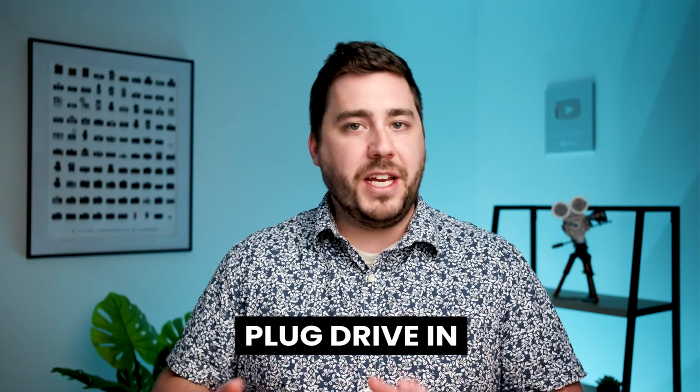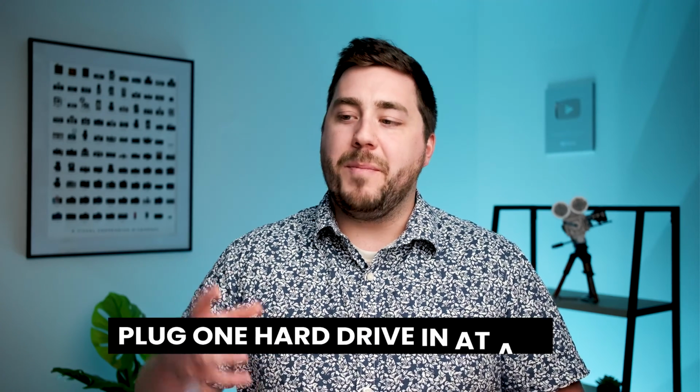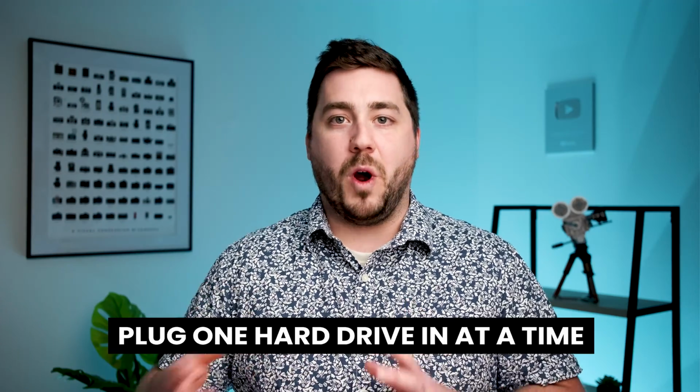Number two, you're gonna wanna make sure that you plug your drive, whatever type it is, into your computer, and you should see it over here on the left in the external section. I really recommend only having one hard drive plugged in when you're formatting a drive because you don't want to inadvertently format the wrong one. So I like to safely remove or eject all hard drives and then just plug in the one that I'm looking to format. In this case, I'm looking to format this Samsung SSD 870 EVO drive over here on the left.